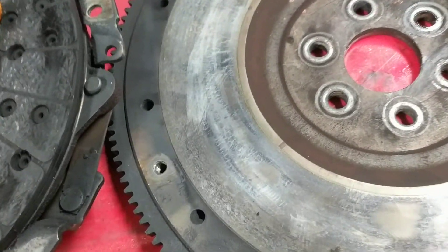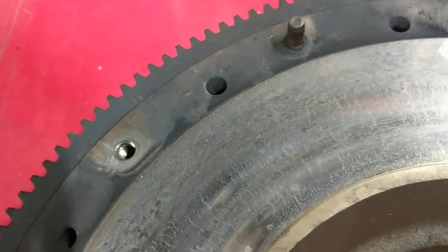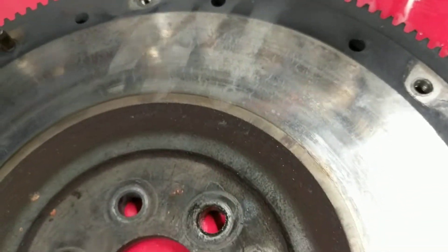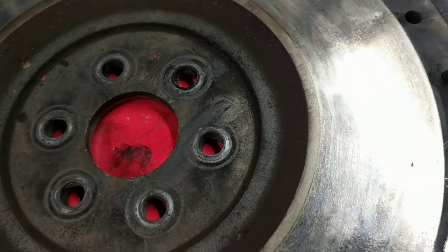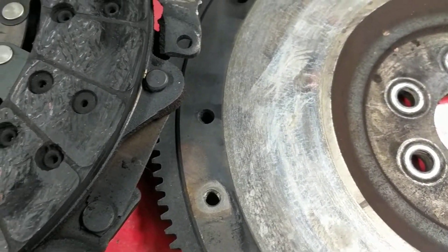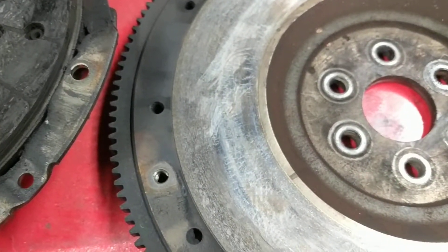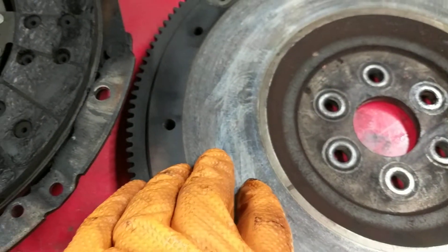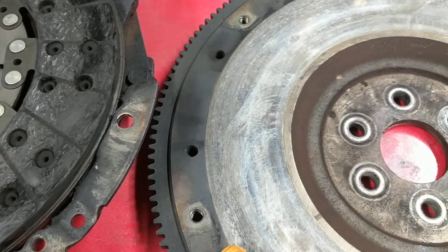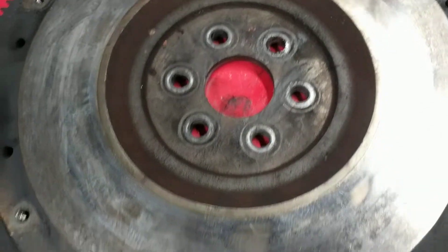See if you can see all them heat and stress cracks. The guy at the machine shop told me, 'Don't worry about them,' and I was like, alright. You pay 50 bucks to resurface it, or like I've done in the past, put some WD-40 and some wet-dry sandpaper — like 220 or 280 — and hit it with the DA, and it works just fine.